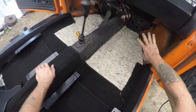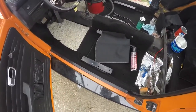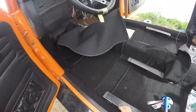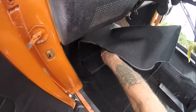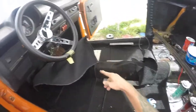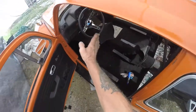I'm going to put these side pieces on there, then put the piece in there. The last two pieces of carpet — I've got it all in the back, and there's the piece that goes up in between. I'm going to cut out for the stick shift and place that up in there. I went ahead and did this side first; I'll clip and trim that little area back there. I should spray some black paint or put masking tape down there so you don't see behind the pedals. Don't glue the carpet too well where the bolts are in case you need to replace the master cylinder. Then I'll flip it over the hump and fold it at the front.